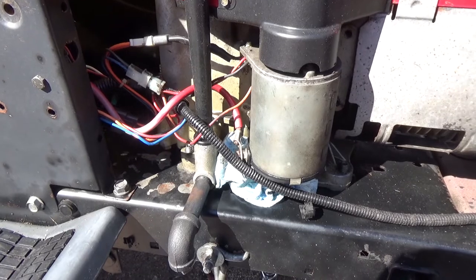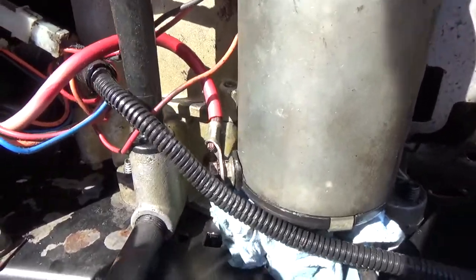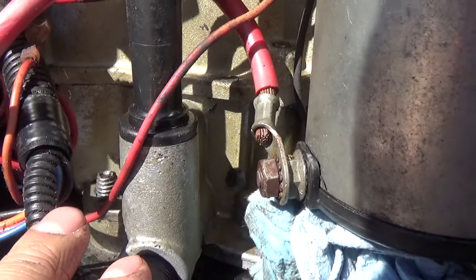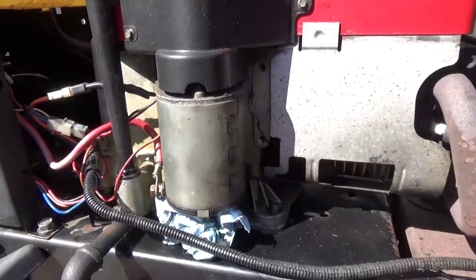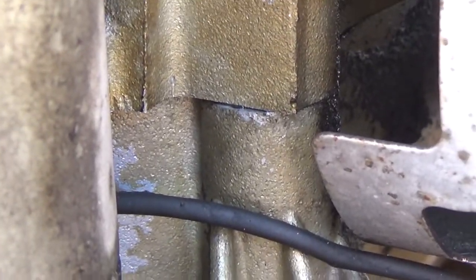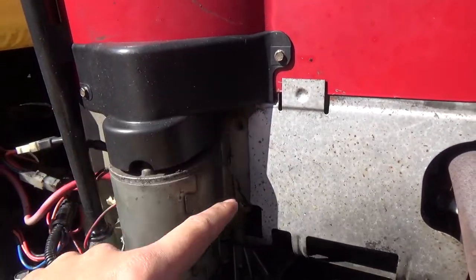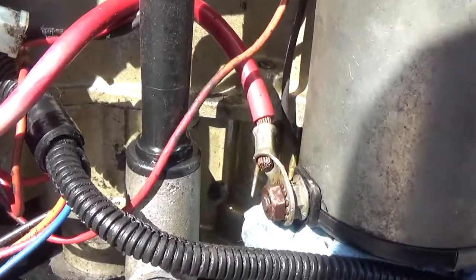After we changed the oil and were running it, we noticed an oil leak right around here — I've got a rag stuffed in there. After I wiped up all of the oil, we noticed it was actually leaking right from in here. So this is your sump down here. On these engines they're split, and right there is where you have a gasket going all the way around your engine. That's your sump where it holds all your oil, and we're getting an oil leak from right in there where the gasket goes.